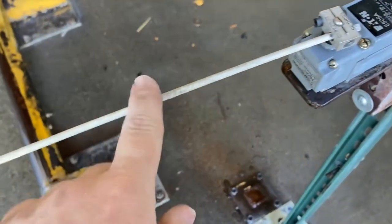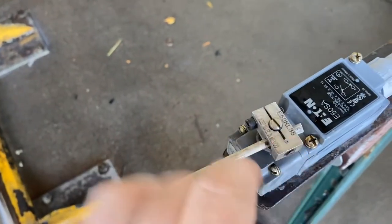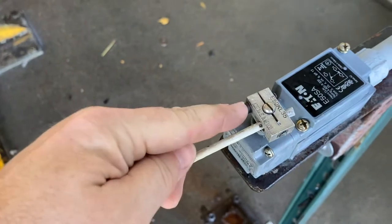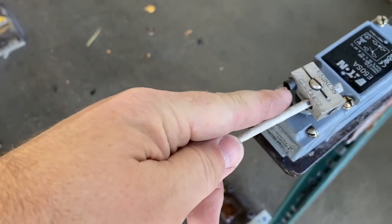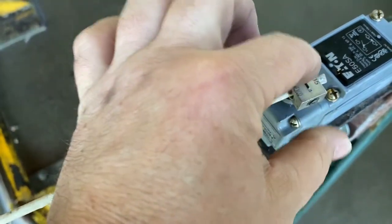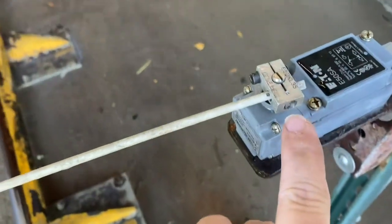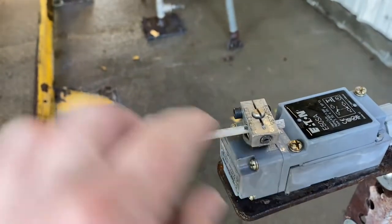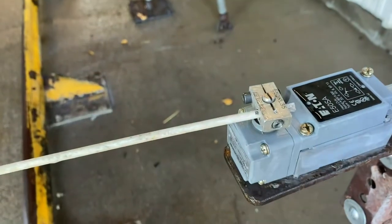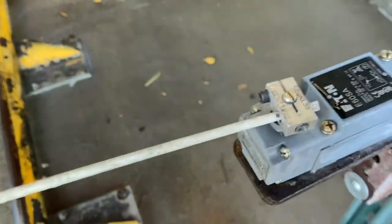This stem here actually broke off, so I had to disconnect this little piece here — the entire thing came off. When you unscrew this little screw right here, that releases it from the center portion which has the switch, and then there's a little set screw that holds it in place. I had to take that out to get the broken piece out and then feed the new piece back in.